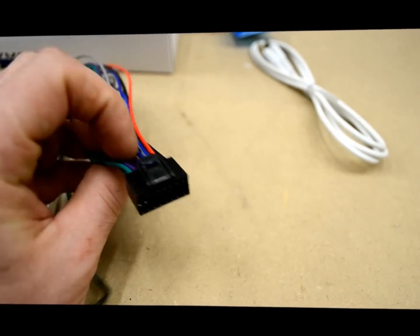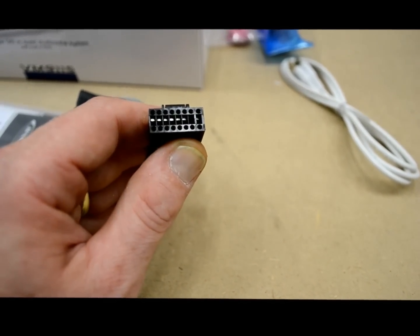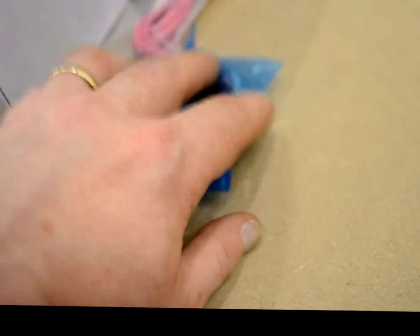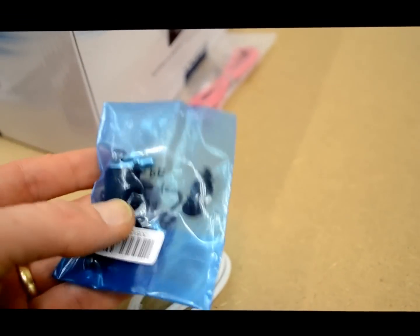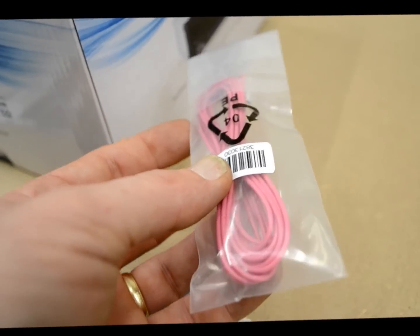For your own knowledge, if you ever lose this harness, a Kenwood standard car stereo harness would duplicate this exactly. They also include a 3.5mm cord, about 3 feet in length, for free. These here are the ISO mounting screws, brackets and a stop piece for the back of the receiver, and an extension for the parking brake.